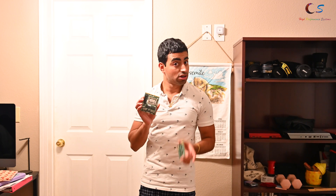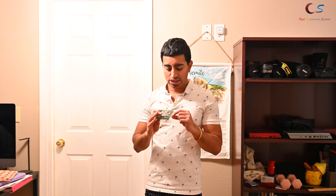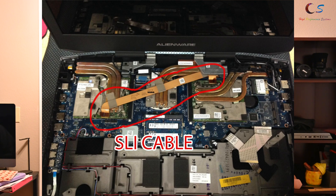They basically released two generations. We're not going to focus on the first generation because it's not really relevant today, but the second generation is still relevant. These MXM modules came in two sizes: Type A and Type B. The only difference was the length of the card, and the heatsinks were actually completely compatible between them. Even though MXM was controlled by NVIDIA, it didn't just mean NVIDIA cards — there were also AMD cards made in MXM format. MXM GPUs even supported SLI and Crossfire, and they were just like desktop GPUs but in a mobile form factor.